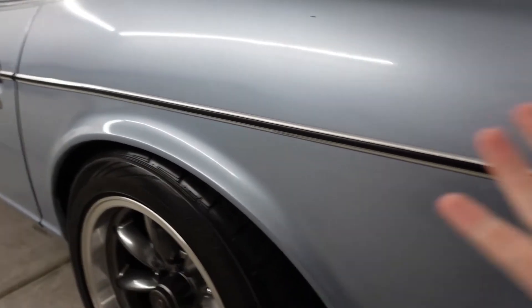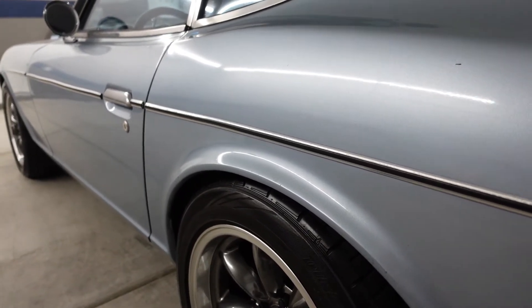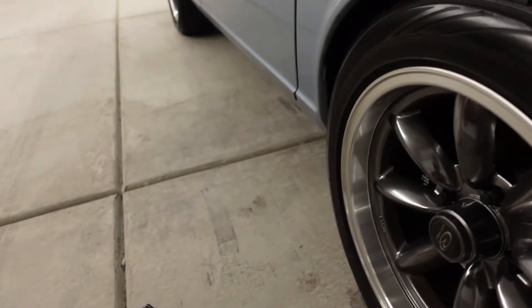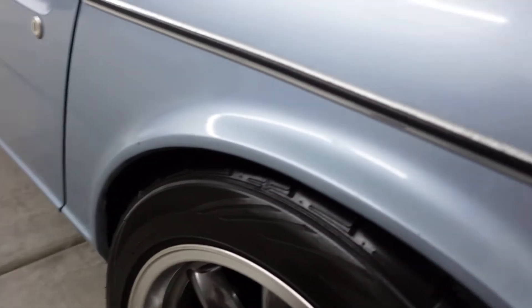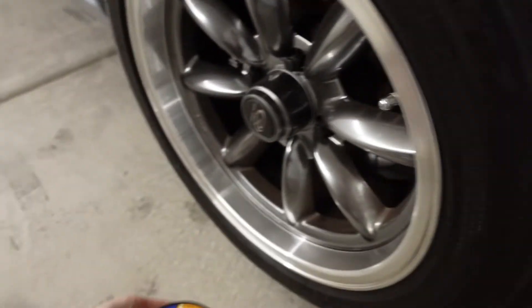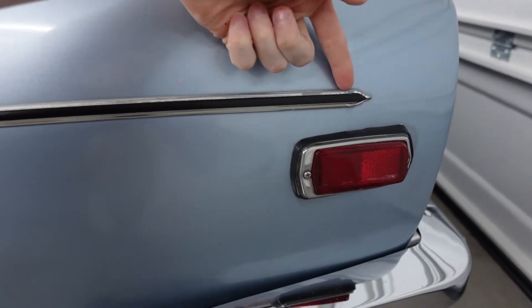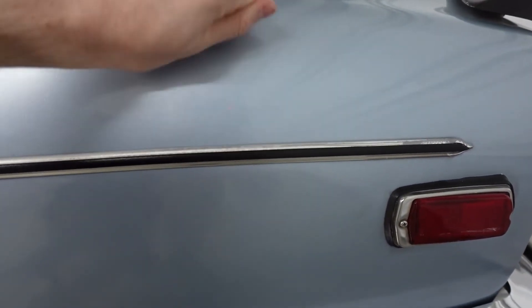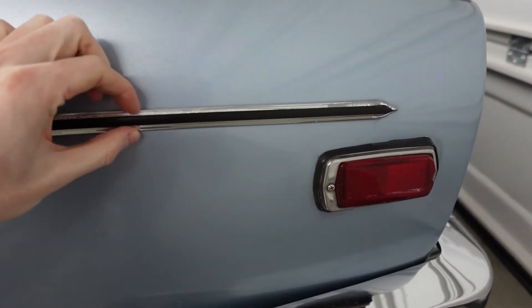I found that on old forum posts so I don't know how reliable it is, but today I think we're going to find out. To remove the trim you just need a couple of tools. We need a heat gun — we're going to heat up the trim and that's going to get the double-sided sticky tape nice and soft. Then you use some fishing line, sneak it behind the trim, hold it on both sides, and kind of saw off the trim. That's going to remove some sticky tape but will also leave a lot behind.